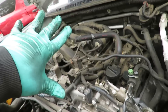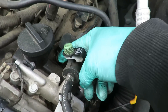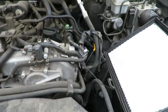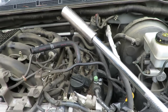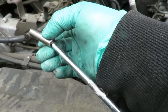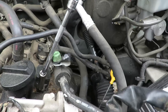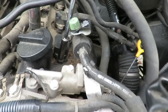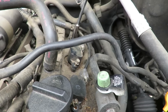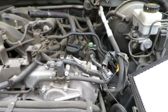Alright guys, let's concentrate on these three coils right here. You have 10mm bolts holding these coils in on each one, and then you've got a plug. Let me take one of them loose so I can show you how the plug comes loose. I'm using my same 10mm deep but this time I have a quarter inch drive extension — this extension also serves as a wobble, and if you push the socket all the way on it locks into place. I'm gonna keep it at the wobble level. Let's take out our three 10mm bolts holding on each coil.